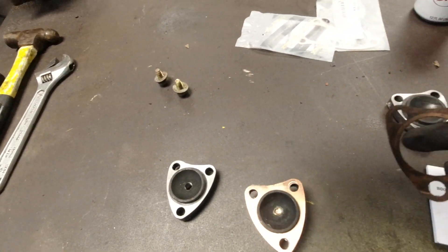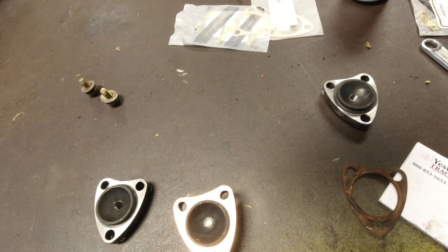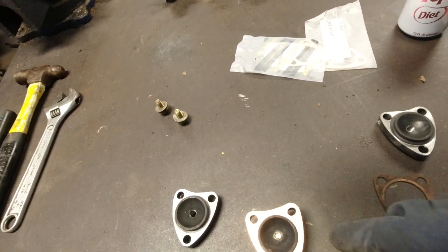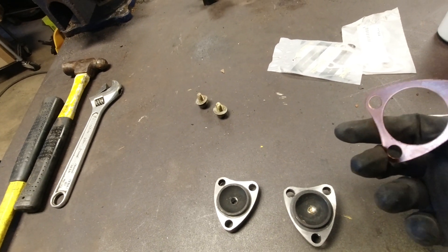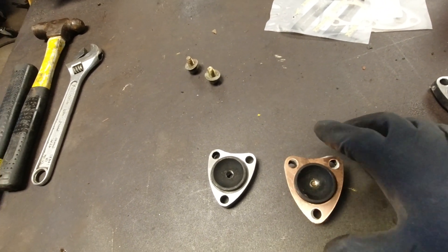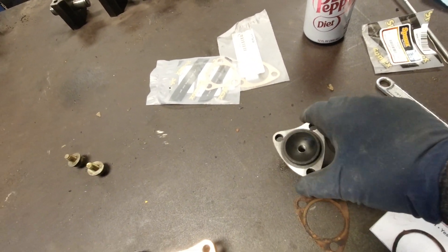The previous owner had actually doubled up gaskets — this is the old one. You see this part where it's shiny. He put this gasket next to the cap, then this gasket next to the head, in order to do the same thing we've done here. It didn't really work well. I've seen people do it and have some success with it, but it tries to blow out — you can see that there, that irregular shape on that ring. So this step is what will cure your indirect injection cap from leaking. I've annealed these, made them soft, and put them on, and I've had some success with that, but it worries me that we've also lost some tensile strength to keep this thing from bulging and leaking outside. So that's a good fix — I've had great success with it. No comebacks after I've done this process.